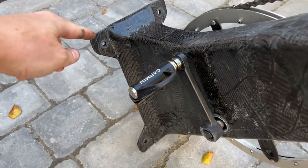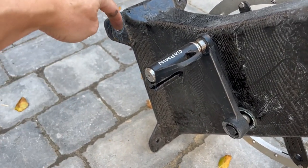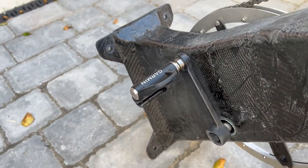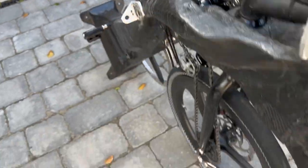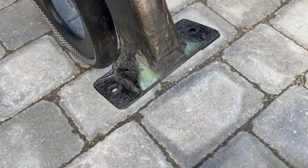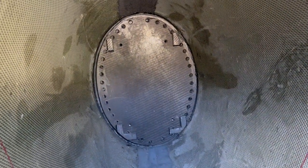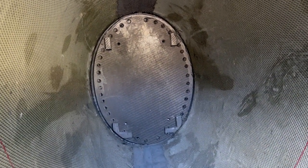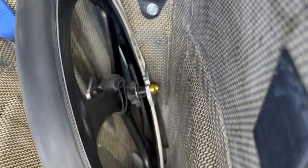The mechanicals bolt into the bike. This plate at the front has four bolt fixings that attach into the bulkhead. There are two fixings here that attach into the top of the bike, and then two fixings that attach to the hull. The two lower fixings go into these mounting points, the two upper fixings go into those, and then you can see the four bolt fixings into the front bulkhead. That's the rear wheel mounted into position.